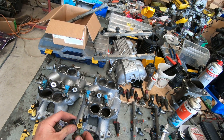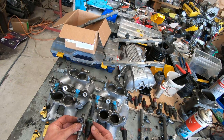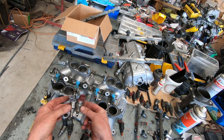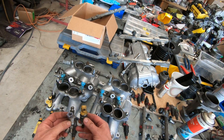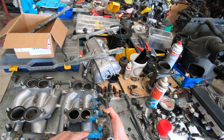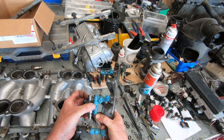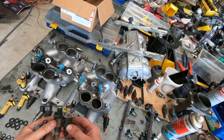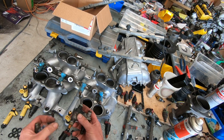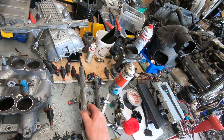RX8 550s — pencil post, exact same plug — fit in exactly. There's a Nissan unit with a little pipe on the top, similar to VL Commodore and some early Nissans — that won't fit. Side-feed Nissan — not going to fit. Side-feed Subaru — nope, not going to fit. Some Asian blue ones — yes, they'll fit. Here's an Audi Bosch-style injector with a bigger bottom o-ring — not really going to fit.